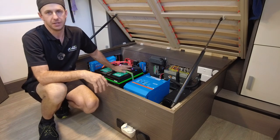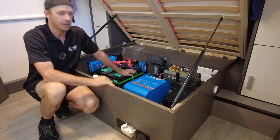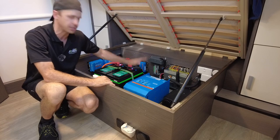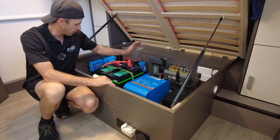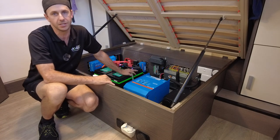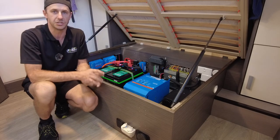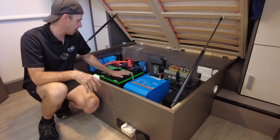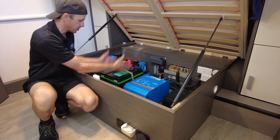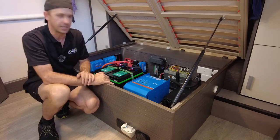Power pull scouts. Now these are Paul's current model 300 amp hour variants, okay? I've upgraded these customers to the 300 amp hours because that was in the fresh order from Paul at no extra cost. So these are 300 amp hours each. So there's 600 amp hours here, guys. That's over 7.5 kilowatt hours in energy storage, in lithium storage. Custom-made, handmade batteries. Absolutely love these. That's why I keep using them. So one of these batteries can run the full load of this inverter. So that is a redundancy thing, and that's why we use them.